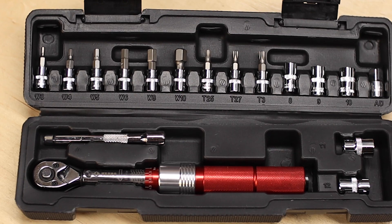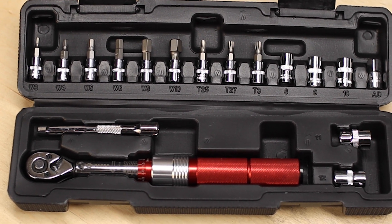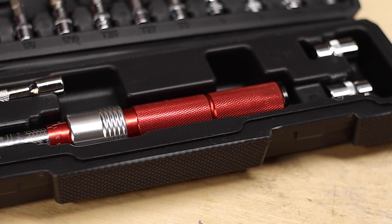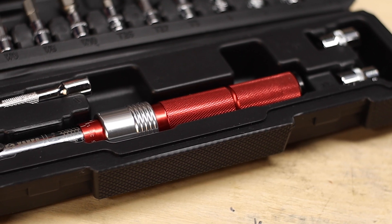Nonetheless, this type of torque wrench provides at least a reasonably accurate and convenient means to apply the proper torque to all the many bolts on your bike. I do also want to mention a few things about this particular wrench. I certainly like the price tag at $40 US. I also like that it includes a case with several commonly used hex and torque sizes, a quarter to three-eighths adapter, and a quarter inch extension. The finish is nicer than many other budget wrenches I've used, and the red anodized and knurled handle is a nice touch. It does seem accurate enough, and for the casual mechanic who mostly wants to make sure they're in the ballpark for a given torque spec, a wrench like this will be totally fine.